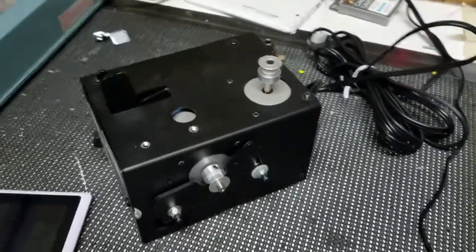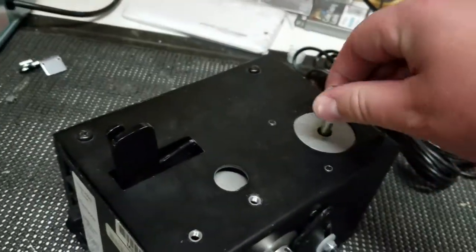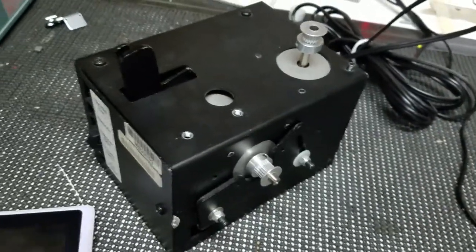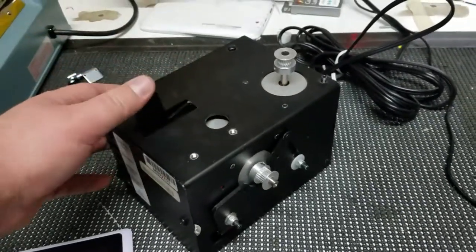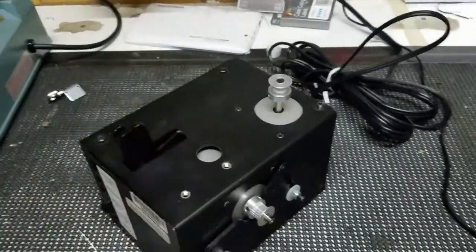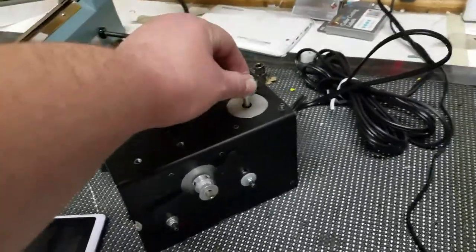I want you to look at something interesting. These little pulleys have little grooves in them that match the teeth of the belts that they run along on your quilting machine. And then you have your lever, which must be locked in place to have your belts tight. Things that can happen if you're getting funny stitching is that your belts might be too loose.